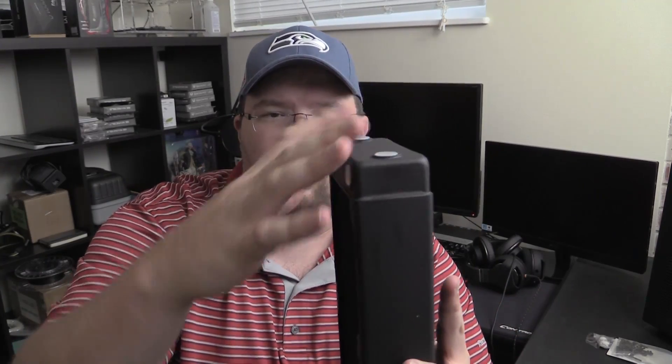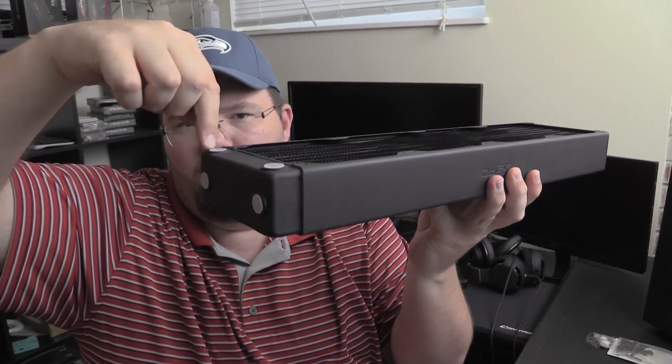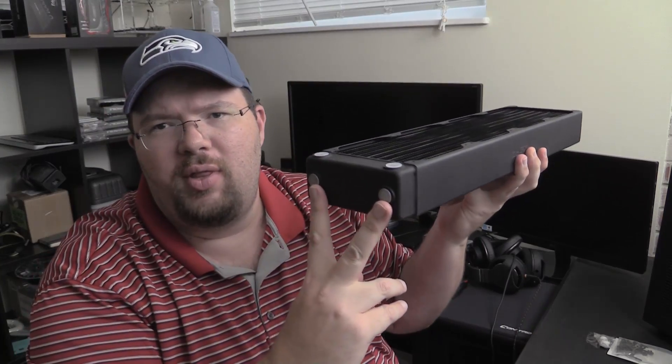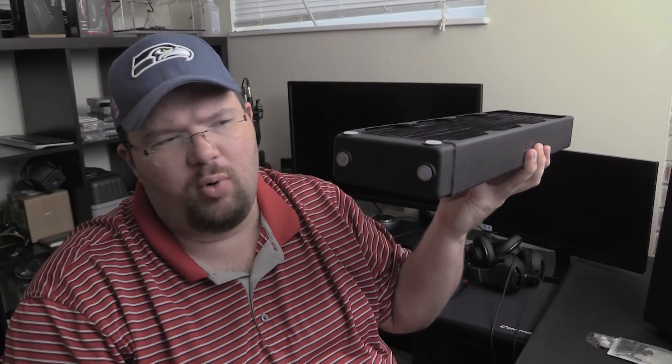The one nice thing about this is it gives you the option of either bottom, top, depending on your orientation, and then side. I was kind of hoping this would be one of the six-way ones, which has ports on the other side as well. Not the end of the world — it just means I'm going to have to rethink how I'm going to do my drainage loop. It's nice to be able to put the top rad facing up so you can crack open that top fitting. Maybe there's enough room in the Enthoo Primo that I can come off of here with 90s and then go down.